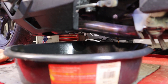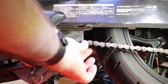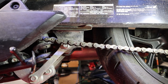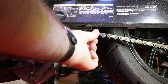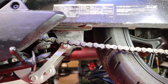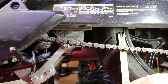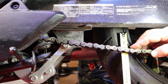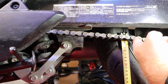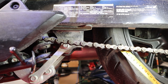This is the lower run of the drive chain right here, and it obviously doesn't get lubed very much. It is pretty stinking loose. It's supposed to have one and a quarter inches — or 30 millimeters — of free play. We're starting there at about 70mm and going up to about 30mm, so we've got about 40 millimeters of free play. It's not terrible, but it's just not that great either.